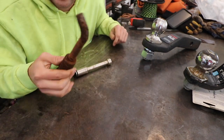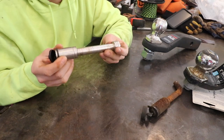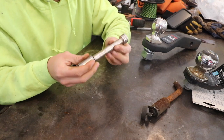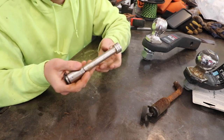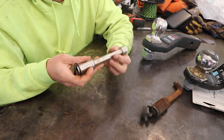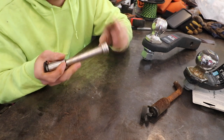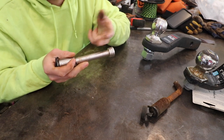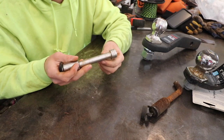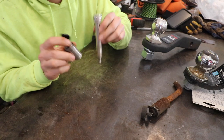This is why I hate chrome-plated mild steel. Here's a much better option: a 304 stainless steel hitch pin that is lockable. Again, 200 times more corrosion resistant than mild steel. I'm not 100% sure this hitch pin will last a lifetime since these do go back and forth and there may be some wear, but stainless steel is harder than mild steel. If it doesn't last a lifetime, it's going to last a very long time.